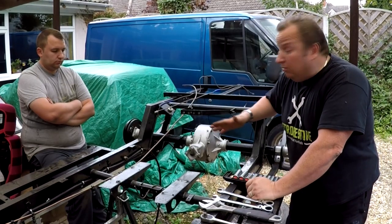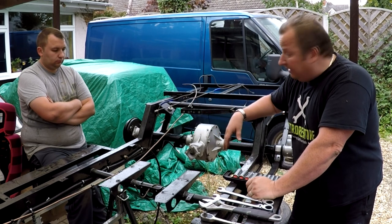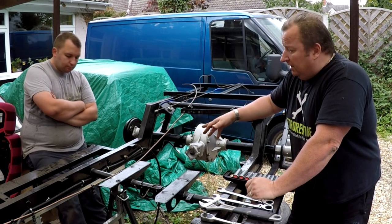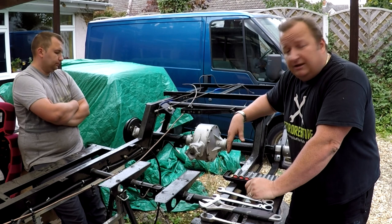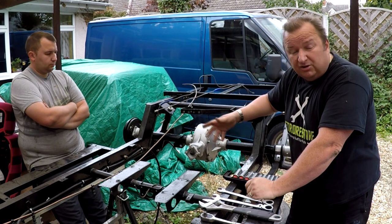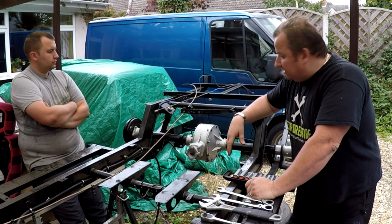So basically I'm back to where I was now with the back axle in, prior to my leak from the axle. I've got 2 pints of axle oil to put in that. I won't do that yet, I'll do that a bit nearer the time, but I've still got these brake pipes to put on here, and as you probably see there's a rubber pipe which I run from front to back, which a few of the subscribers said really should be a more solid pipe. So I actually got a larger diameter copper pipe for the fuel pump, because it's a mechanical fuel pump on this one, and obviously having the larger size and using just a brake line type pipe could be beneficial for the engine. So that's that.